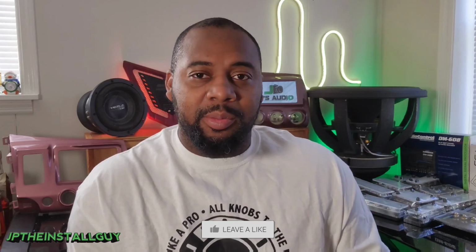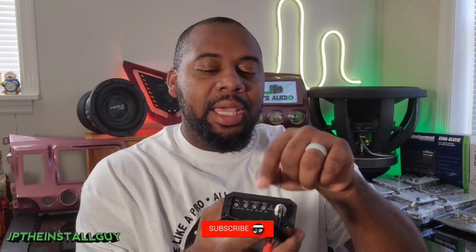Also, we can have clean signal coming into the amp, so the amp is getting what it needs signal wise, but we can still be distorting the power on the output. For the ones that don't know what I'm talking about, this right here is our Power Sport line amplifier from Tesla. It's the TZ600.1, and here are your level adjustments right here. Now, one of these actually says sensitivity. For most amplifiers, it'll say gain, but I'm glad this one says sensitivity, because that's what we're doing.